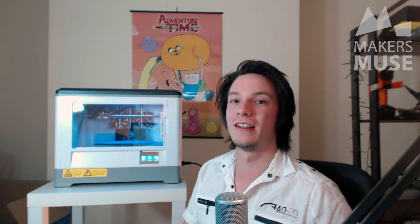It actually has two fans in the back as well, which will power up to keep the machine cool when printing PLA, or just below too hot when printing ABS. I've noticed if I'm printing a long ABS print, it'll sit pretty much silent until the internals get just a bit too hot, then it'll exhaust the hot air to bring it down a little bit — which is really good, because you don't want the extruder motors overheating and softening the filament before it gets into the extruder tubes.